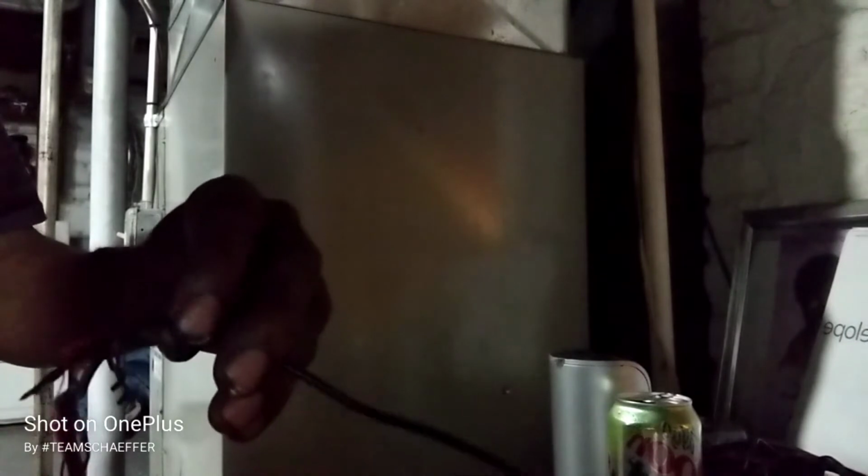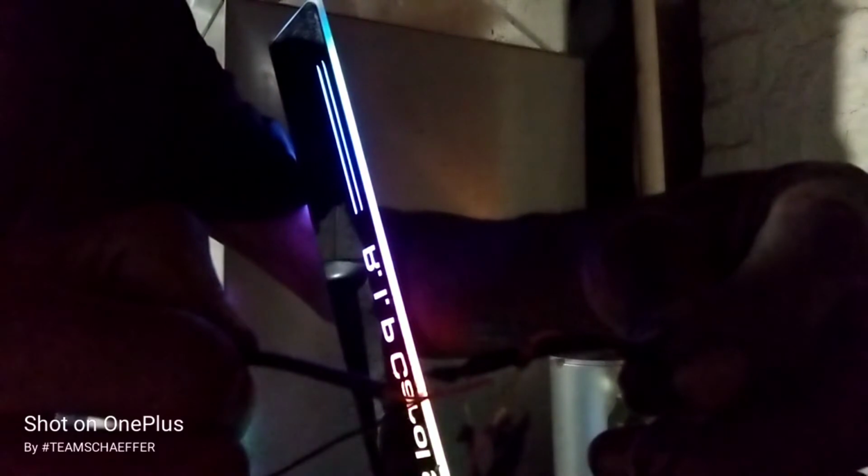All right, YouTube. I got it spliced up open. See, got power to the box. Got a ground. I'm just using this light. You know, I test things out before I put it on the real thing, but you can mess around and short your stuff out. But I already got the ground hooked up. So I'm just gonna tap the positive to see. Hopefully I don't get electrocuted. Got power. So we know this thing takes 12 volts in the car, so we should be straight to power on the radio. Let me get to it. Gotta be careful.